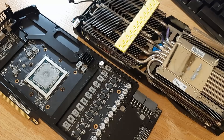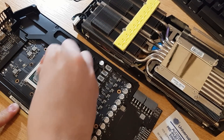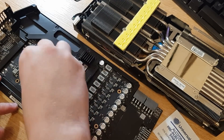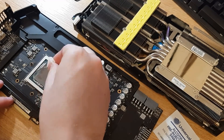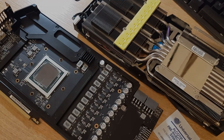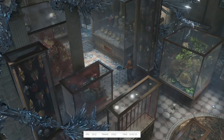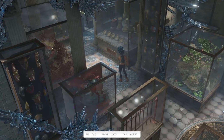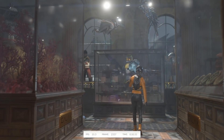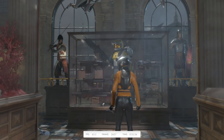Obviously the standard graphics card rule of thumb applies here, and I've taken the opportunity to remove the OEM thermal paste and reapply it with some fairly average MX2 - nothing high performance or fancy, but with ASUS's approach to the VRM cooling, I didn't want to take any chances. With the card reassembled, it's time for the moment of truth. Room temperatures are the same, idle temperatures of the GPU are in the same ballpark, and the Ryzen 7 CPU is in the low 30s at idle, just like it was before the pad change. The Time Spy stress test was run again for the same duration and all the data was logged, with some interesting findings.